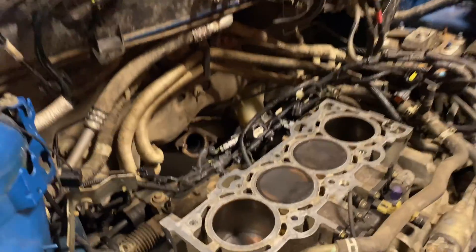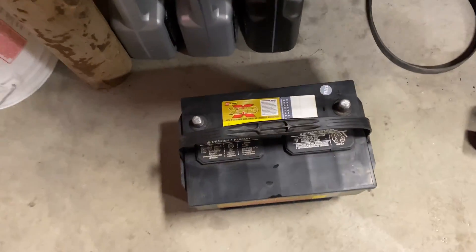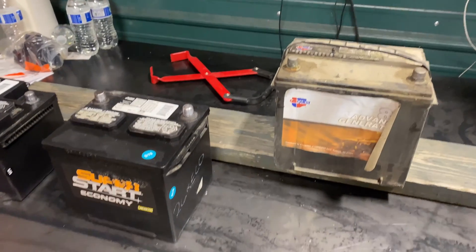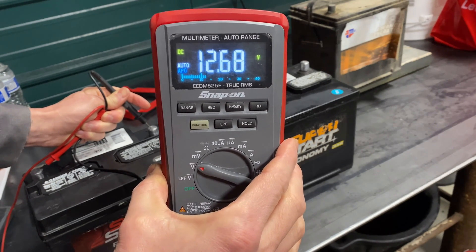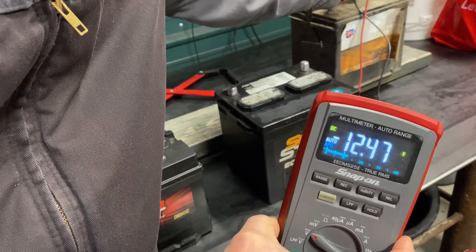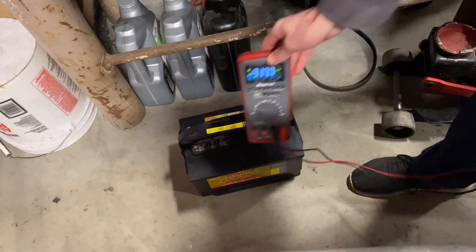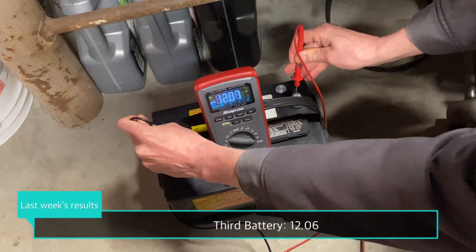One week later — the rain's turned to snow, so let's go inside the shop and see how those batteries are doing. Here are the batteries, still here in the shop. Haven't started any fires. Let's see if we've got the same voltage as before. 12.68. I'll put the original reading on the screen. 12.20. And our control group — the one sitting on the wood being insulated — 12.45. Here's the big battery sitting on the floor for a week: 12.06. It doesn't seem like they were discharged all that much, so I'm going to leave these on the bench and on the floor for one more week to really give it a good test.